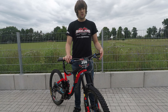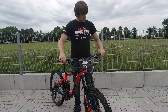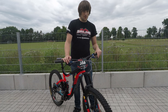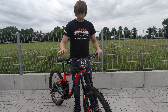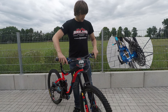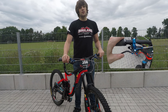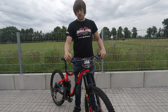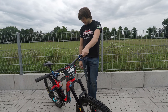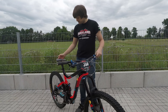One of the biggest changes I made to the bike when I got it was the brakes. It came with Shimano XT brakes with the vented ice rotor — they were pretty good actually — but I hate the fluctuating bite point, so I moved to the Hope brakes. I was torn between Hope and Magura; in the end I went for Hope — I'm English so I stick with English-made stuff. I went for the M4 version, 200 rotor at the front, 180 at the back. Loads of power and modulation. What I love about these levers is you can control both the reach and the bite point. I got them in blue — it goes well with the bike and matches my pedals.